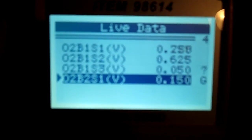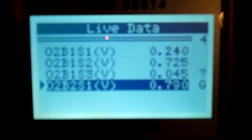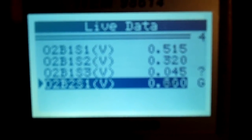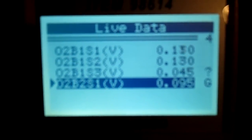We're working on the 97 Chevy Blazer again. Big surprise. Has a 4.3 liter in it. It's a two-door, and obviously the automatic transmission. And the problem I'm having is we have the O2 sensors here. We have 4 O2 sensors on this vehicle. I just replaced the O2 sensor before the cat closest to the cat. And I thought that was going to fix my problem, but apparently that did not fix my issue.